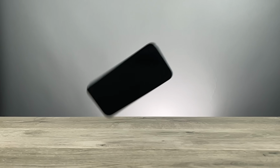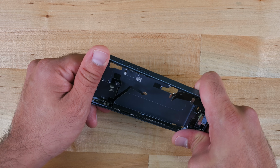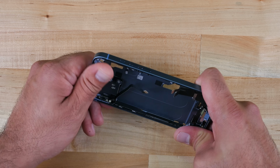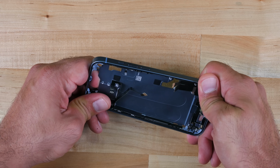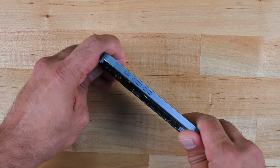Achieving the high levels of durability that we've all come to expect, including drop resistance and torsional rigidity, is an incredible engineering challenge. When you drop an iPhone 13, its metal frame absorbs that shock, transmitting and spreading the force across the glued-in battery and sturdily adhered rear glass. The iPhone 14 meets the same challenge in a different way. The new mid-frame sits between the display and the guts of the phone and takes the brunt of force distribution across the frame and battery.